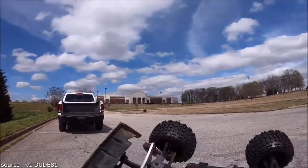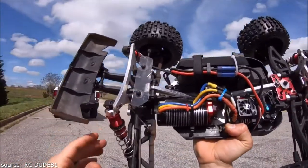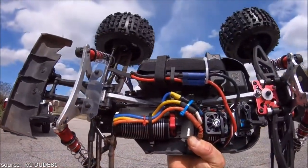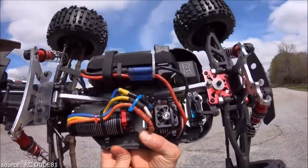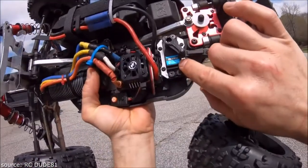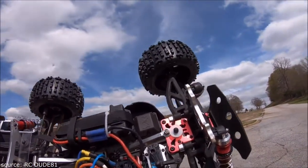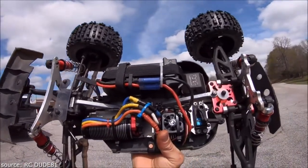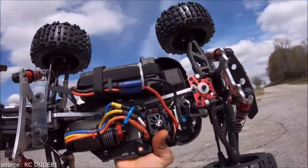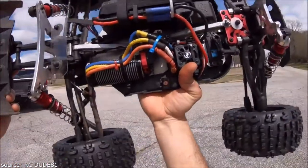A couple things in here is I did go ahead and go to this M2C ZRS bladderless shock system and pistons. I'm just gonna give those a try on here. Hobby Star 1730 KV, a 4092 paired with a Max 8. And also I'm gonna be testing out, as I said in my last video, this Zoske 35 kilogram servo. It's butter smooth and really quiet, and it does have a lot of torque. It's just not really fast, but for bashing, for a $39 servo on Amazon, that's not bad at all. I'll put a link to that down in the description, but I'm definitely gonna be giving that a test out here and just see what's up.